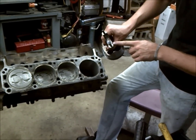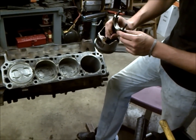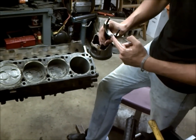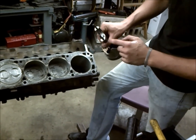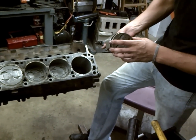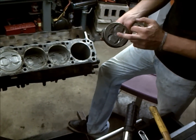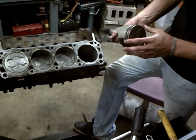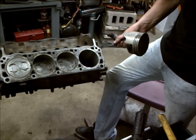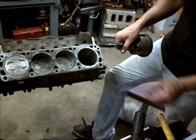As you can see, there's quite a dramatic lip on the side of the connecting rod, and on the other side it's completely flat. The flat sides of the connecting rods are supposed to touch each other, and these lips face the journals. Another thing, like I've said previously, if you're doing a re-ring job, you want to install the pistons back in the original bores because this is a balanced rotating assembly. So it's always a good idea to keep it balanced by putting them back in the same place.